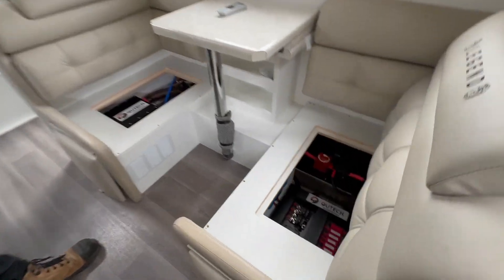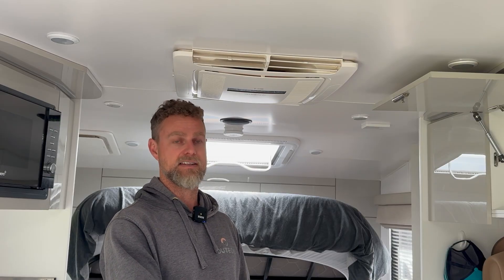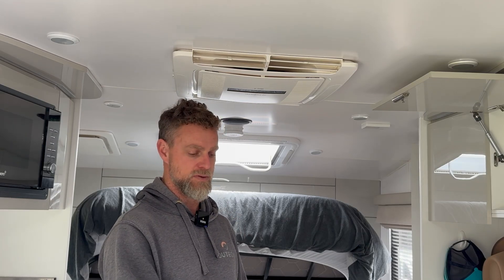With this van, what we've gone ahead and done is use the parts of the system that were good quality and could be repurposed — the Victron equipment, the Redarc equipment, and the Enerdrive equipment — consolidated into our system. We've mounted everything under the seats, which is part of what we do. Getting everything under the seats gives us a really good opportunity to use space that's not ideally usable otherwise, and also gives us good weight distribution over the axle. We had to do a little bit of modification with the water pumps to move those out of the way.